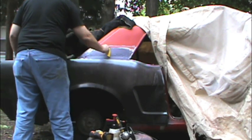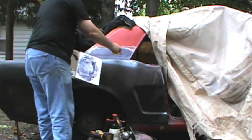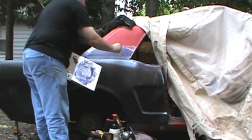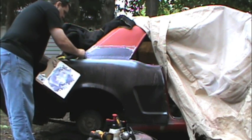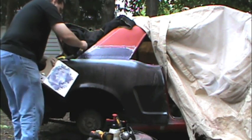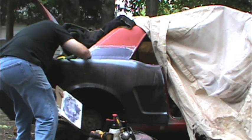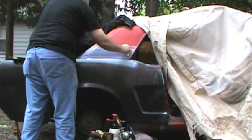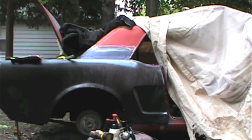Now in this video, what you normally could do is just sand this and then apply a plastic filler straight on top of that once it's sanded. But I'm not going to have time to do that in this video. So I'm going to go ahead and spread this, get it good and even, and then I'm just going to apply some self-etch primer on there so that any of the metal that I did not get fiberglass on won't start rusting. Then whenever I do continue — it'll be a different day — I'll sand the self-etch primer off and then continue with my body filler. That's it for this video. We'll see you in the next video when we are applying body filler. Thanks for watching. Talk to you soon.